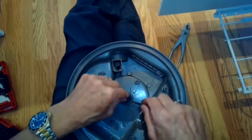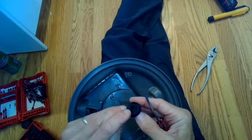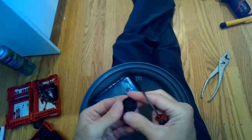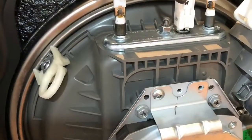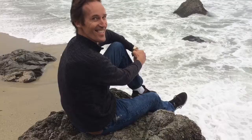If you still notice a leak, it's possible that the sump assembly didn't get pushed down. It could also be the little seal for the circulation pump — they tend to wear out, and that would just be a slow drip if that seal failed. Here's the sump assembly back in position. Thanks so much for watching, and please subscribe.